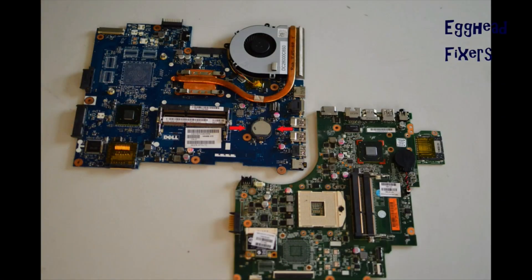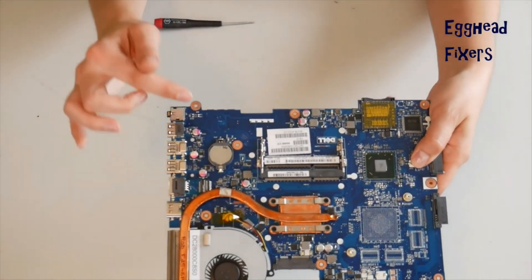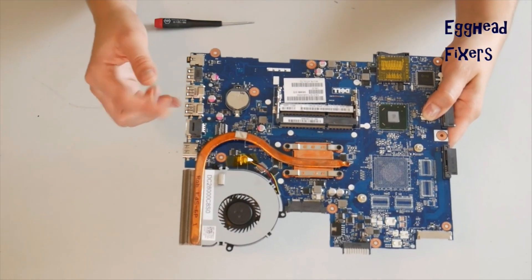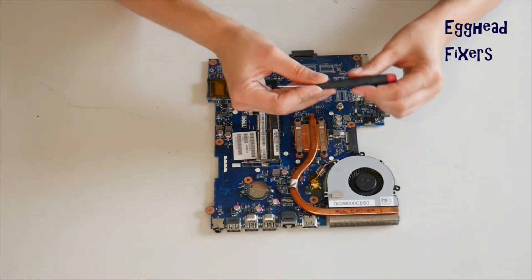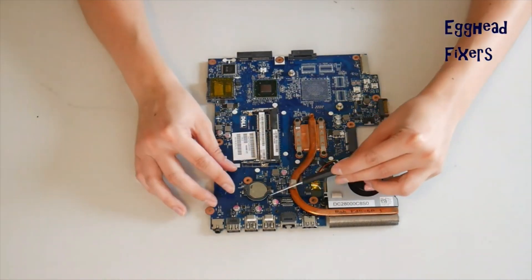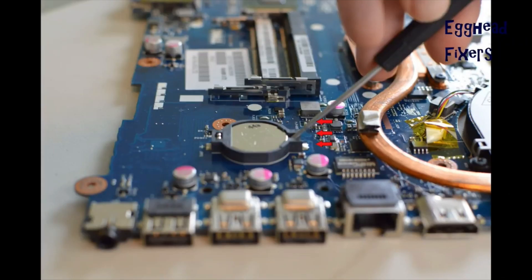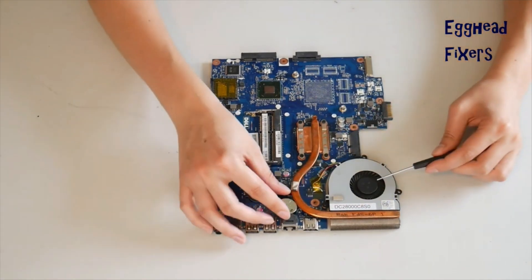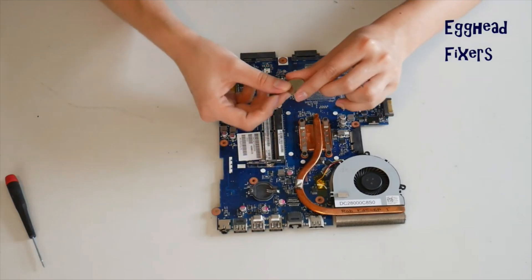Now the cradle kind of CMOS battery. The cradles vary drastically from model to model. This is the most common kind, so we'll demonstrate it on that. But if your cradle looks different, you may have to change or adjust the way you do it. Sometimes there's a flap or a piece of metal you have to move. For this kind, you take the screwdriver, set it there, and push it to the left gently, being careful not to break the cradle because once you break it, it's very hard to fix. So you have to be very gentle with it. Now I'm going to go ahead and slide it back in there.